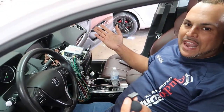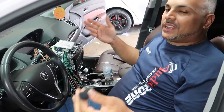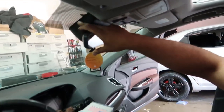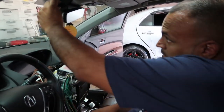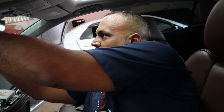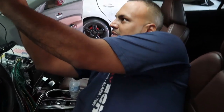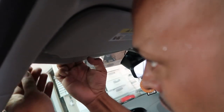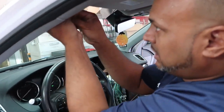Now we've got everything initialized. We're going to get the microphone that came with the unit — putting it where you can't see it is very important. If you look on the side of this mirror, there's a little plastic area — I've already wiped it down, and I'm going to go ahead and attach the microphone right there. The client has the option of putting it where they want. You're really just going to get the wire and tuck it all the way down into the vehicle, start running it across, bring it down, run it up to your device, and you have the microphone connection.